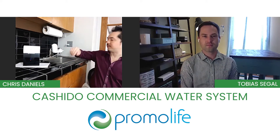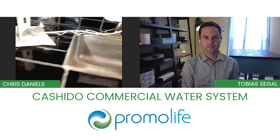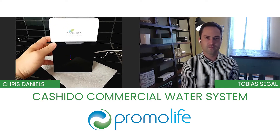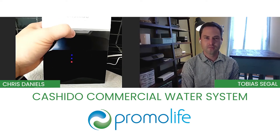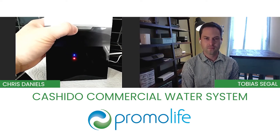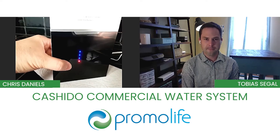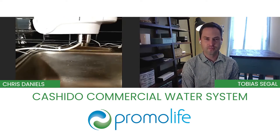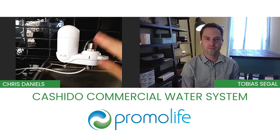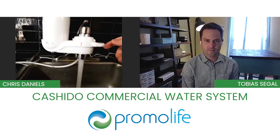Let me give you a quick overview of how this unit works. This is our machine — it's the same size and shape as the external machine. Over here we have a mode button; if you press that it allows you to adjust your ozone output. We have levels: low at 100 milligrams per hour, medium at 150, and high at 200. This red light means you've got power going into the machine, and it installs on your faucet via the aerator just like our original. Over here in my office I have it installed with a pure water filter for when I want to drink water, and over here I've got my ozone water.